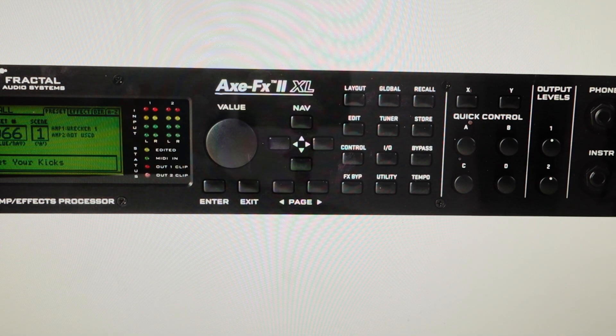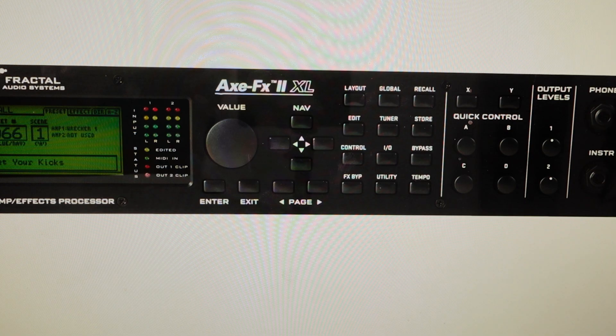So basically, from the menu, you're going to select the menu page that's called Reset System Parameters. When you get there, you'll have this option and it will say Reset All. You'll get a dialog prompting you to Reset All. Hit the Enter button to execute it and everything will be reset to the factory defaults.